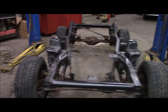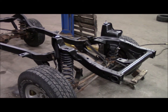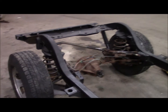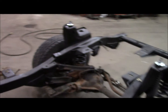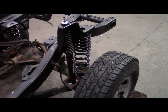Got accomplished most of what I wanted to do tonight. Got the axles out of that rotted frame — that frame's in the scrap metal pile. Installed them in the new frame with a 2-inch budget boost in the rear, stock springs, new shocks, and some Grand Cherokee V8 cargo coils in the front with new shocks up front as well.